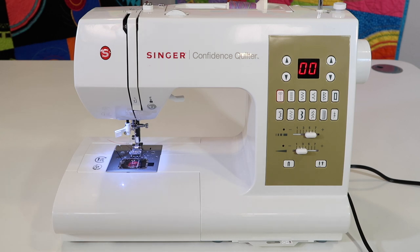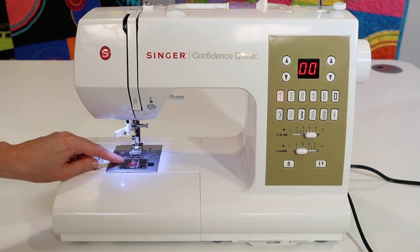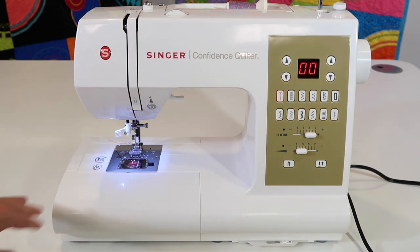If you're having any trouble and it's been a while, you're probably going to be surprised at what you find underneath the throat plate. Lint and dust from your fabric gets pulled down below. Linty fabrics include cotton, fleece, flannel, even felt — and those wonderful minky and cuddle fabrics that are practically like faux fur. That's going to get down in your machine and bog things down, cause skip stitches, and make thread break when it's not supposed to. Those are all reasons to clean this machine regularly.